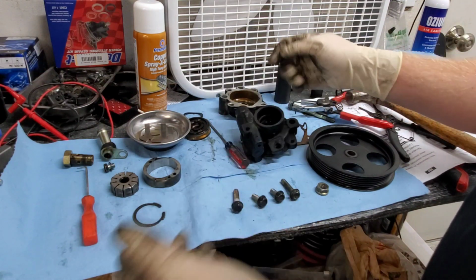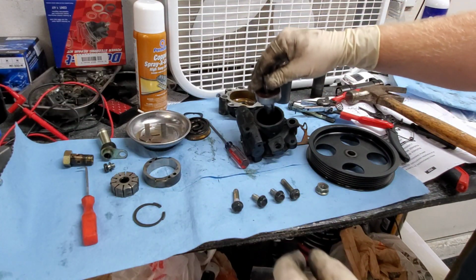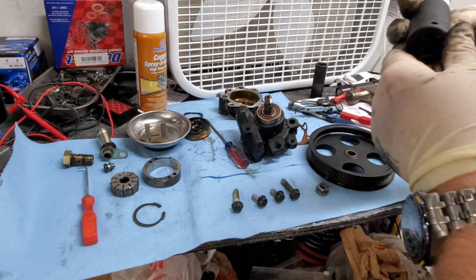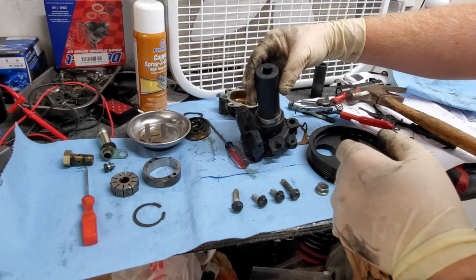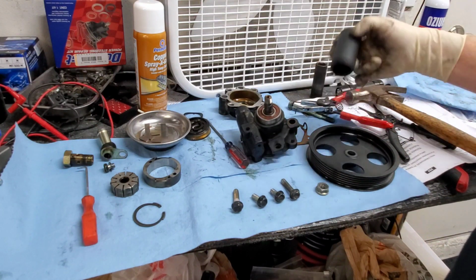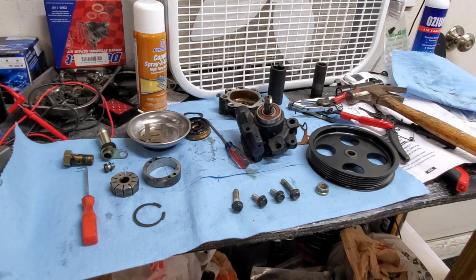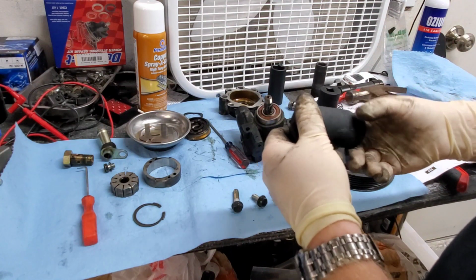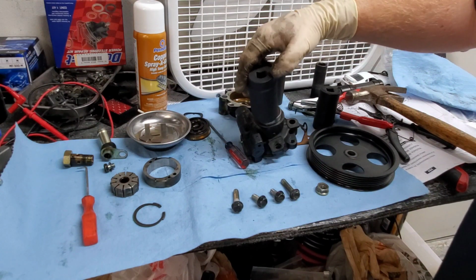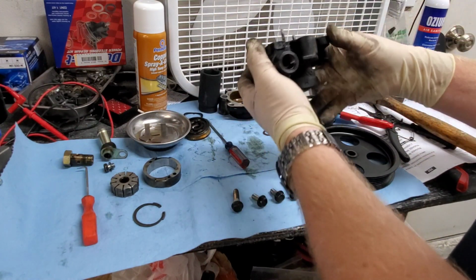From there, you're going to replace the gasket. Once you get the halves all back together, you're going to put your shaft back in. Okay. You're also, again, going to use a nice large socket. This one's not big enough because you don't want to smash on that seal, because that seal is where the bearings are. So I'm going to need a bigger one than the 24. It's my 30. There we go. 30 is going to be perfect. So there we go. Get that back in.